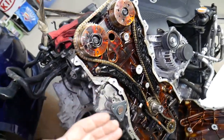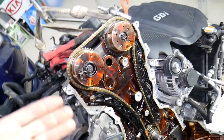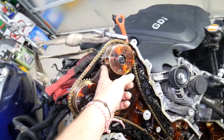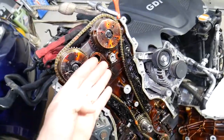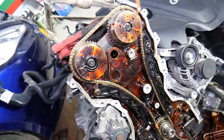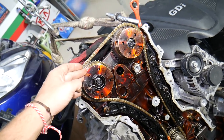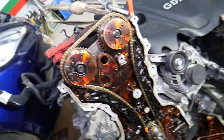If your car starts slowly — cranking for a long time, wanting to start then not, and when it does start it's running unstable without enough power — that can be a sign of a jumped timing chain. Another symptom is loss of power, because if it jumps one or two teeth the timing will be off. You'll most likely have an engine light and a code relating to timing chain components, such as camshaft/crankshaft correlation codes — anything from P0010 to P0017.